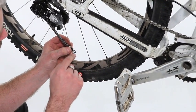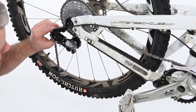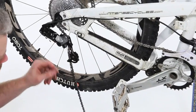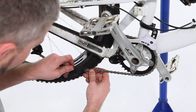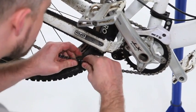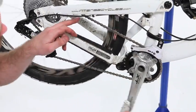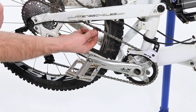On this 10 speed link there is an arrow which indicates the direction of travel, so make sure you get that right. We've got a type 2 SRAM mech here which has got a super stiff spring, so to make it easy to join we can bring this locking feature into play — it makes it a lot easier. You can either pull the chain apart to connect it, or if it's a bit tough like this one, just pedal the link onto the top run and give a good pedal like that and it'll be joined properly.